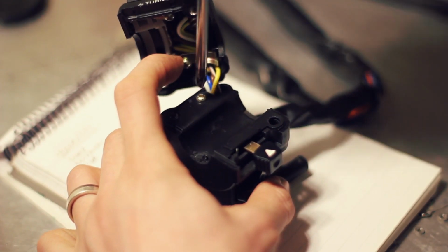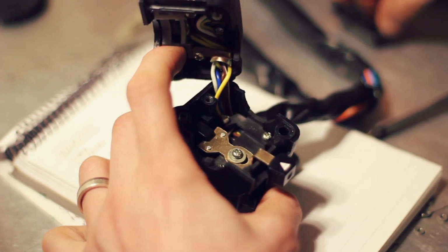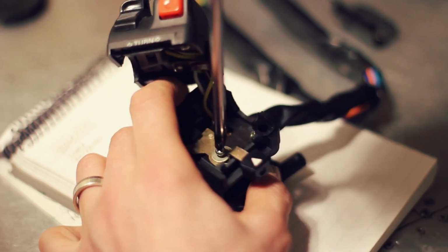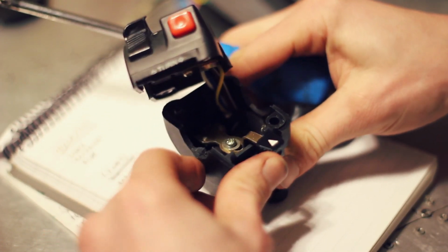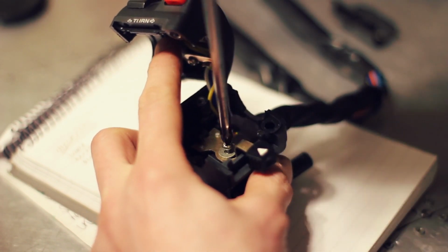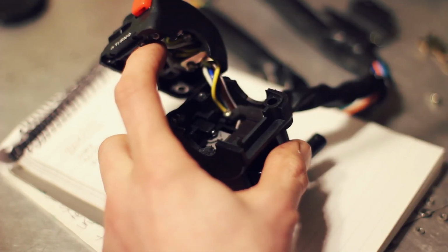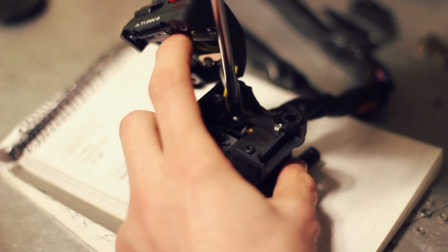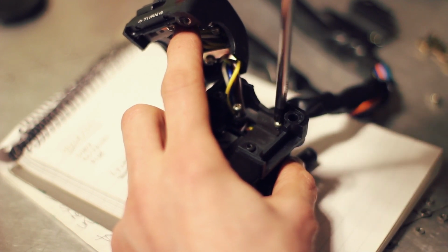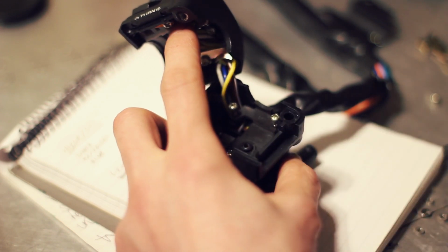Now just look at this bottom bit. Let's remove this cover. Put that to one side. I need to remove this. Now watch out for these switches, because they are the kind of switch that can go left and right, and then you click in the middle just to reset it. There will be a ball bearing flying loose somewhere, so you just need to be careful of that. There it is there, that's not going to pop out, so we'll be fine for the moment. 3 screws covering that, and then we can at least see inside there, and through the process of elimination we can actually tell what wires what.